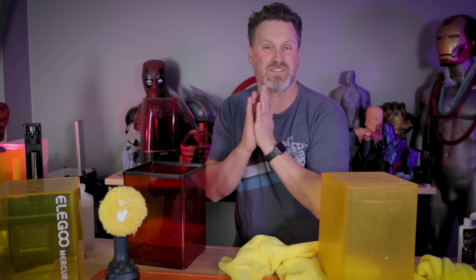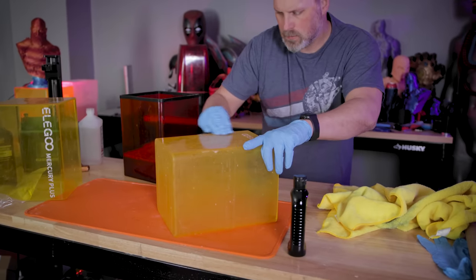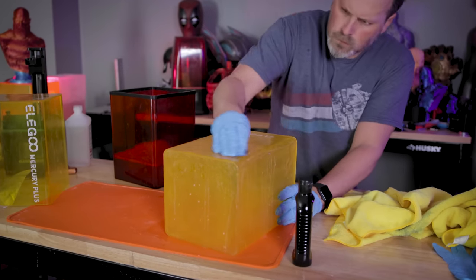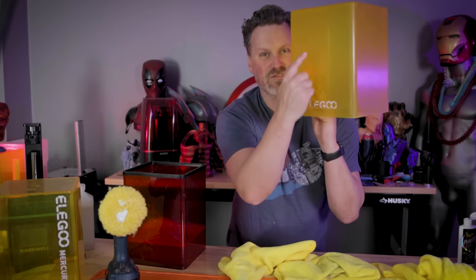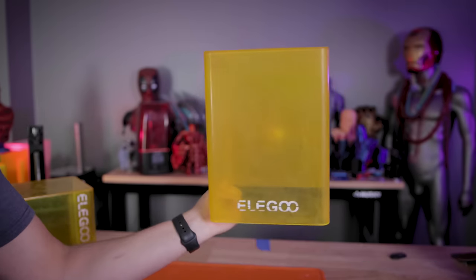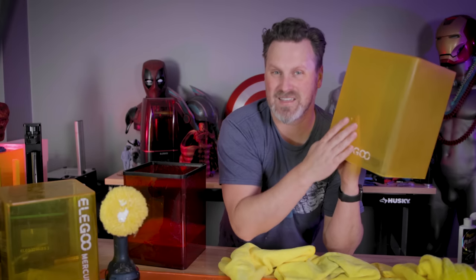So I jumped back in while editing this video — it was driving me nuts that I didn't get the clear results I was hoping for. I decided to go back and re-sand one of the yellow panels, starting at 1000, then 1500, then 2000, 2500, all the way up to 3000 grit. Look at the results — this is so much clearer than what I was seeing before. This is getting very close to what the original panel looked like. I think that's the trick: you just need to go higher in the wet sanding before you polish.